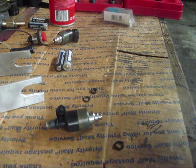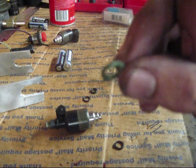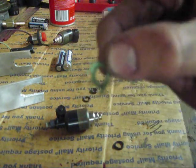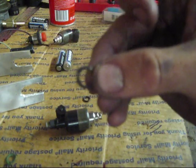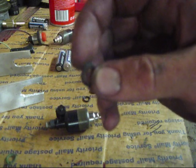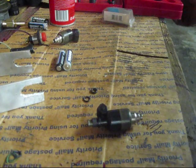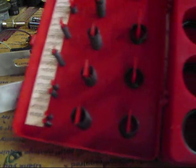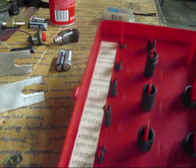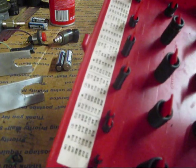I'm going to show you this here. This seal actually ripped — you can see it's about half the thickness it used to be and it will not work. The bottom one wasn't in too good a shape either — it's flaking up right there pretty bad. So they're bad seals. What I've done is I've gone through my little O-ring box right here, and I found this top one up here makes a pretty good replacement. It's number 11, by the way.